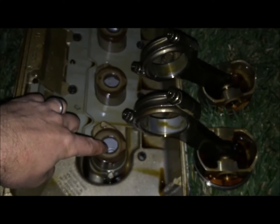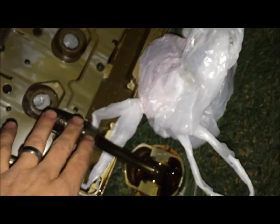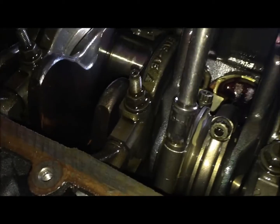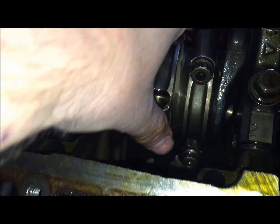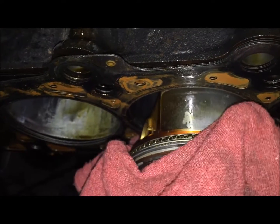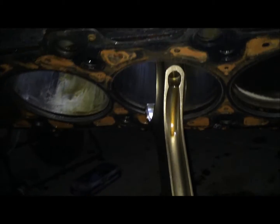We're lining them up with the cam cover: number four, three, two, one — which would be the passenger side. Number eight, seven, six and five will be for the driver's side. Here comes number six. There's the next one — SVT on that one, facing forward. That one has some riding on it. Here comes piston number five as well — SVT lettering up front facing forward still.